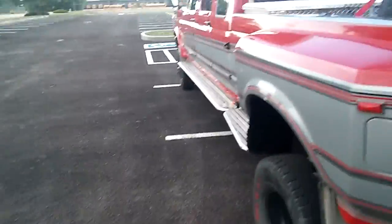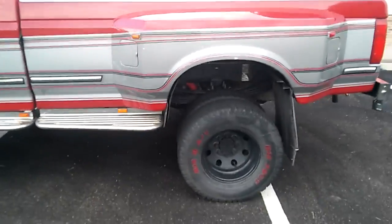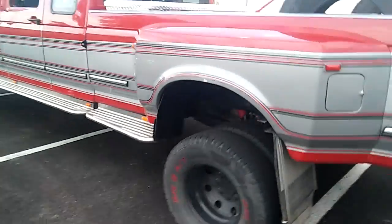Now you're maybe also wondering, here's my brake line. That slack. It's a 4-inch lift kit with 6 leafs in the pack, 1 overload, 4-inch block, 3-inch tapered. So you get, that's the factory line. Still got quite a bit of slack in there. Other than that, I went through everything meticulously. New center pins for the leaf spring. New hardware for the leafs. New U-bolts. Everything's anti-seized to make it a hell of a lot easier next time getting this stuff off.